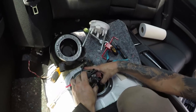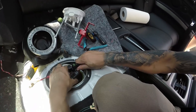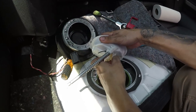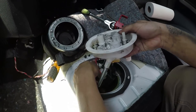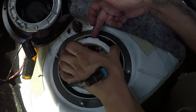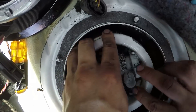Now connect the line to the top of the fuel pump and start the top hat assembly by connecting the electrical connections. Rest the float in — it clips in like that — then connect these to the top of the hat. With everything connected, slide this right into the bracket and reset the fuel pump in the tank. There's a groove it slides into on this side. Slide the groove into the appropriate spot, and be sure to check your gasket — if it needs replacing, go ahead and replace it. This one's in good condition so we're not replacing it.